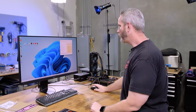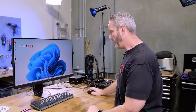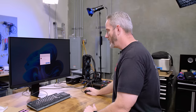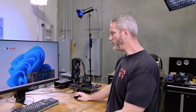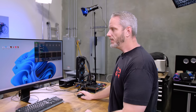If you recall, spoiler, we ended up having approximately a 10C drop from the stock IHS stuff, which was like 95C. Remember, we were hitting 95C no matter what, and AMD was like, that's normal. And we're like, no, it doesn't need to be the new norm. And we kind of proved it using DeBauer's tools.